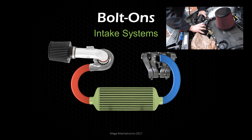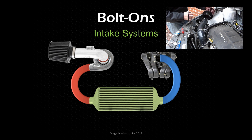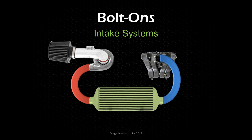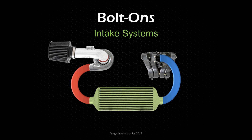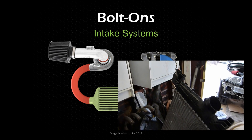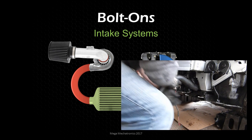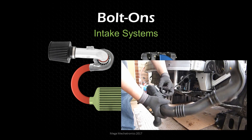For bolt-ons on the intake side to help with breathing and cooling: we have a short ram intake, also known as a hot air intake. There's the hot side of the turbocharger intake tract going to an extra-extra-large intercooler that is about four times as heavy and four times as massive as the stock intercooler, so there should be a lot of cooling potential there. On the cool side, there's more intake tract tubing into the LUV intake.